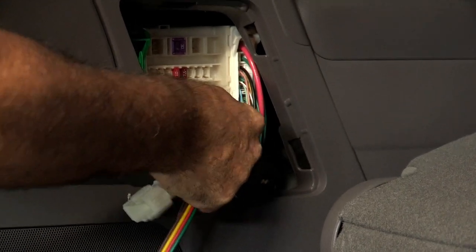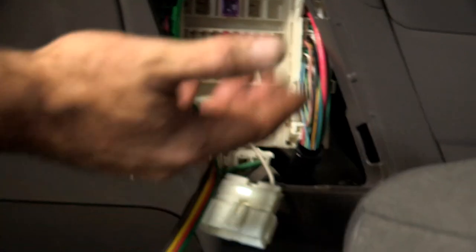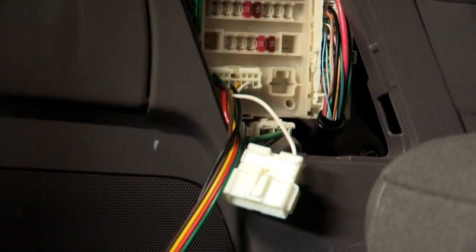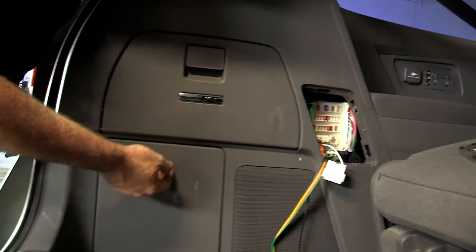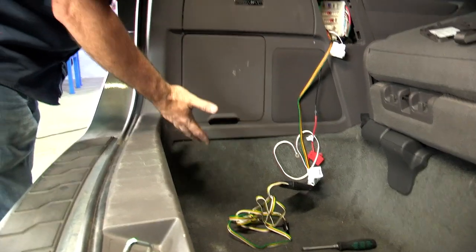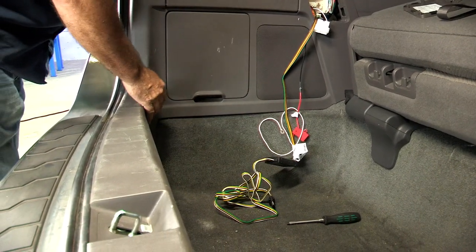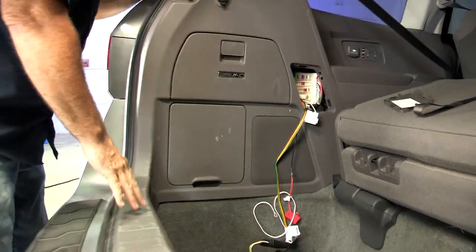We're just left with this one connector. We'll go ahead and plug it in — clips right in. The rest of this will get tucked in. Now we're left with all this wire here. We want to go ahead and pull this paneling out so that we can route it behind the paneling and then down to this area. We'll find a nice place to store it when we're done. We're also going to put a ground back in here.